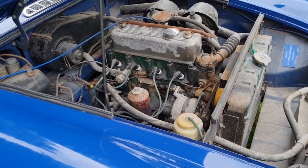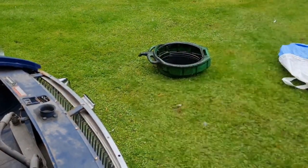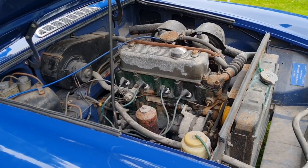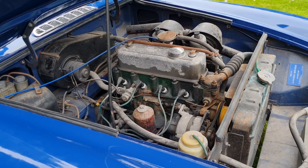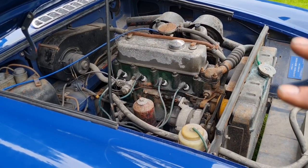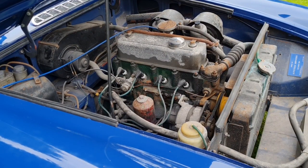I've already jacked the car up off camera and let the oil out. There's the oil in there, so she's got no oil in it. But we have a leaky rocker cover gasket, so we're going to be doing that, doing plugs, and doing the oil filter. Points condenser are absolutely fine, I've already checked them. We're just going to do a really basic engine service. The air filters are good as well, so we're not replacing them, but everything else is going on.